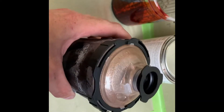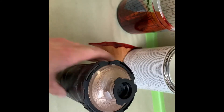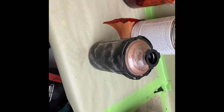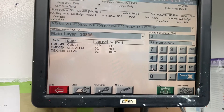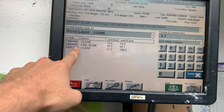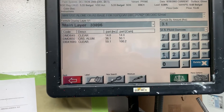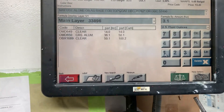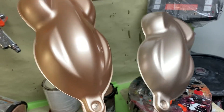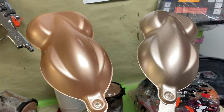So I've got some panels in the booth and we're gonna do a letdown panel. We're gonna do two and three coats — not gonna go one through six or anything like that, just two or three coats of candy. So I'm gonna base my letdown panel and base this speed shape labeled with the 650. Then we're gonna use the same formula but replace the 650 with 1696, the lenticular flake. These two speed shapes are done with our base colors — the one on the left is the 1696 and the one on the right is the 650.